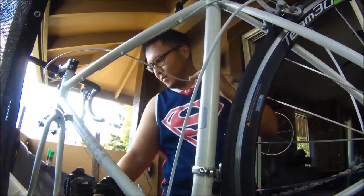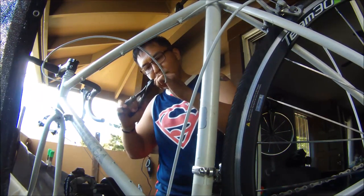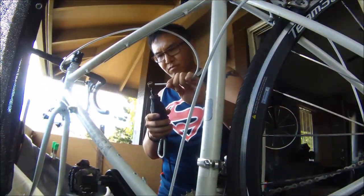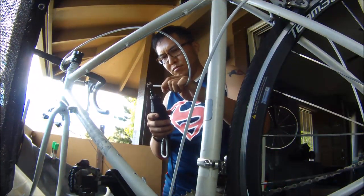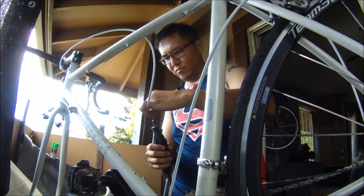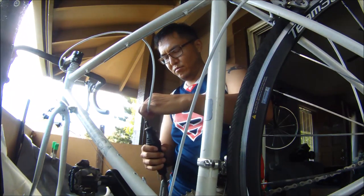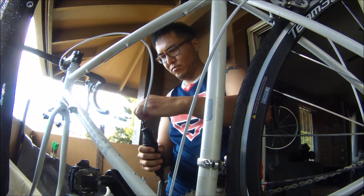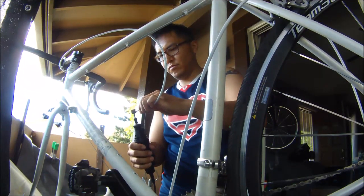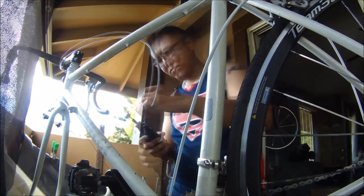When cutting brake cables, you can flex the cable a little bit to make it easier to cut. It's good to have a rotary tool such as a Dremel with a sandpaper piece to sand down the sharp edges of the brake cable to make it perfectly flush when you install it into the housing or the ferrule area where it connects into your frame.